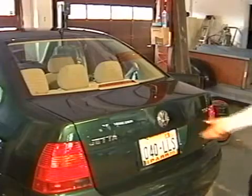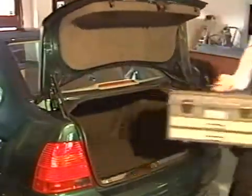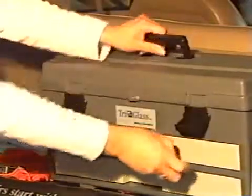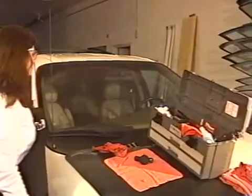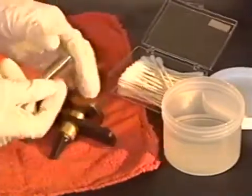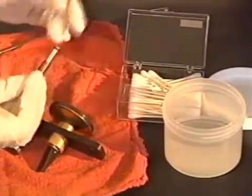So, what's the best way to get optimal use from your Tri-Glass windshield repair kit? Learn and practice how to use it. Take a moment with this video to learn important principles and techniques in order to avoid the common mistakes and pitfalls. The first important principle in achieving a high-quality windshield repair is to keep the injector and the O-rings clean. This eliminates problems with contaminated resin, which could result in repair breakdowns.